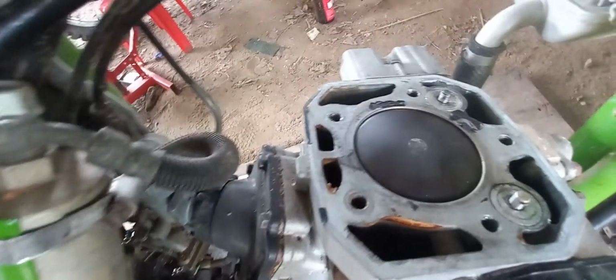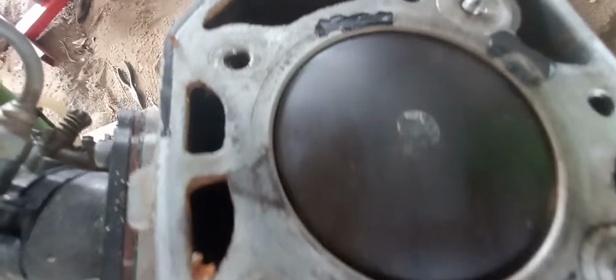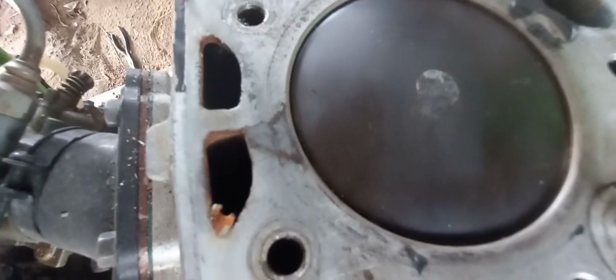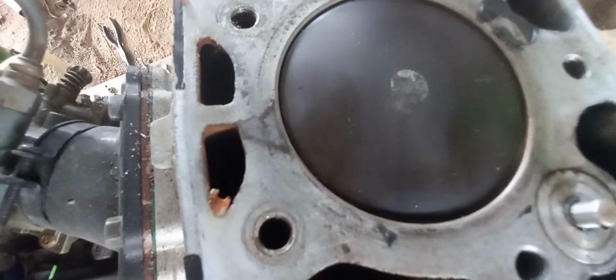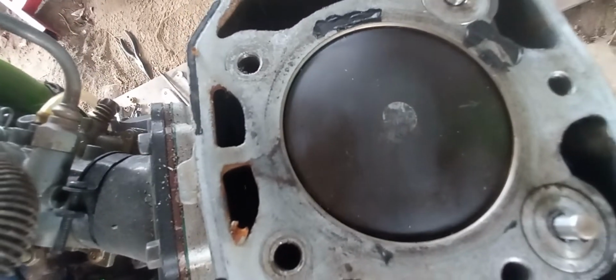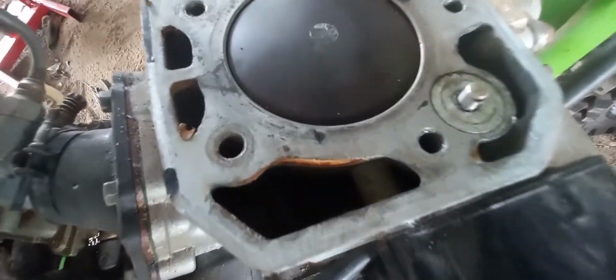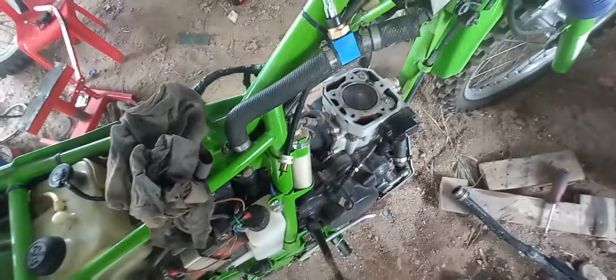And if we go over to the other end of things, that burn mark there, see it? Going straight across to the right hand side of the water jacket. That's where the water was coming in. Or shall I say, it's where the gases were getting out and water was getting in. So, we've got to clean that up and check that lot next. Fingers crossed then.